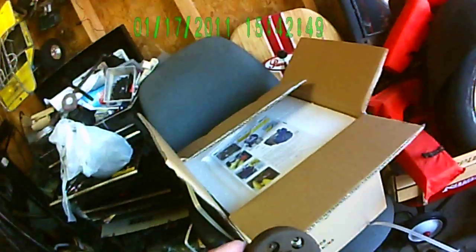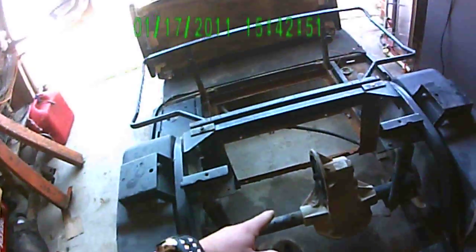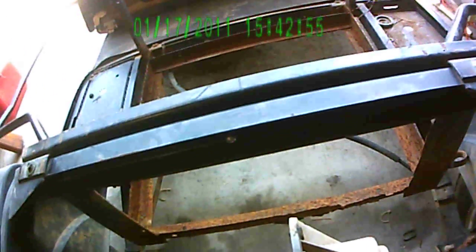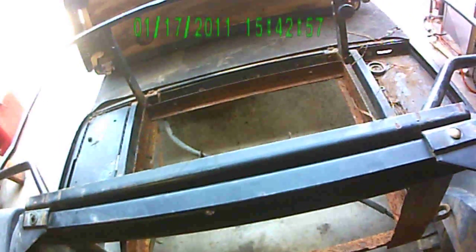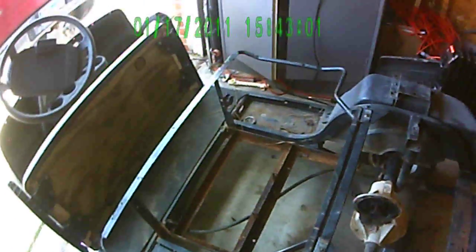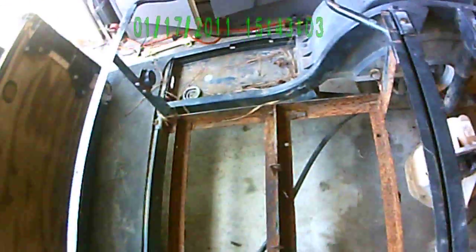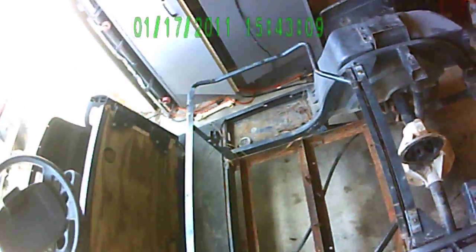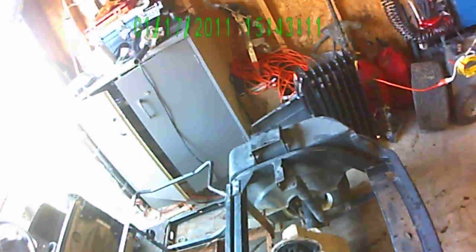You can use a fuller engine on here as long as it's semi-automatic or you run a clutch. But the problem is all the gears in here plus the gears in the motor make it too low-geared — you'd be in fifth gear doing five miles an hour, which is not fun. That's why I went with the go-kart motor, and I'm not going to worry about reverse.